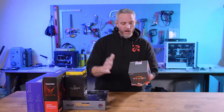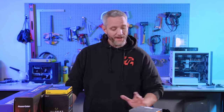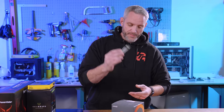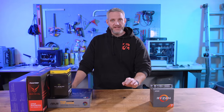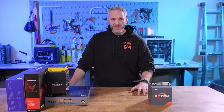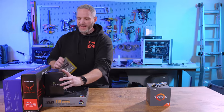That's why we're going with the Ryzen 2700. The Zen architecture is still plenty good for games today and will be for quite some time. It gives flexibility for live streaming or video editing in the future. It's coupled with 16GB of 3600MHz memory. Second-gen Ryzen is still very dependent on fabric clock and memory speed — the faster the memory, the faster the CPU — which is why we're pairing it with 3600 and not something like 2666.